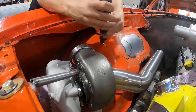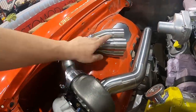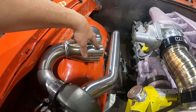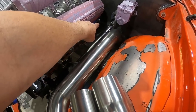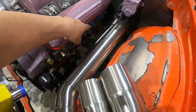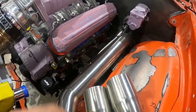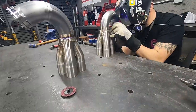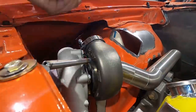We got our collectors in and they are looking saucy. We had to cut out the bottom of the fender well — I only dropped it down about a quarter inch, maybe a half inch — just to get these primary runners level with the head. We're going to do our farthest primary first to get a length on it, then match the remaining primaries so we have an equal-length header, or as close to equal length as we can get. I'm going to start on the driver's side first because we have a lot more stuff in the way — I'm a firm believer in doing the difficult side first so you can match the easier side.